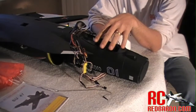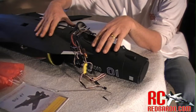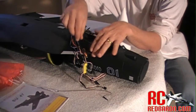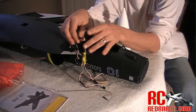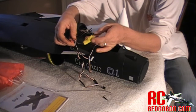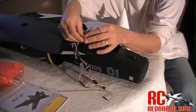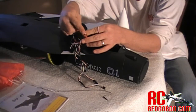Okay, so we've gone ahead and attached the front section to the main fuselage — got that glued in. Before you attach it, make sure you decide what you're going to do with the power system. I went ahead and soldered on a Dean's connector, making sure that I connected the BEC to the system so that I can have power to my servos. Make sure you do that before you attach the front, as it gives you a lot more room to work with the wiring system.